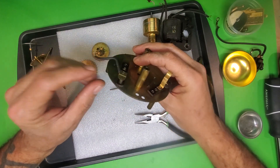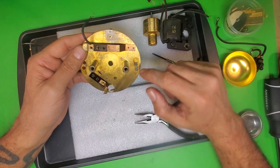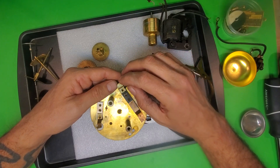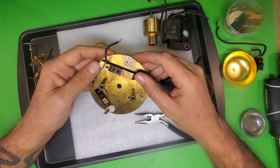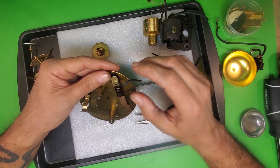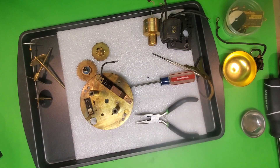This wire right here you want to be very delicate with. I can tell that somebody's been in this one and worked on it — these wires over here have heat shrink tube on them, which is nice, meaning I don't have to do it. In any case, this is what we're left with, and now it's about cleaning up all the parts, testing the rotor and the coil, and then flushing the rotor and taping the coil if they're good.